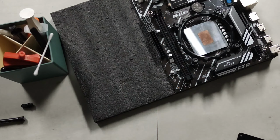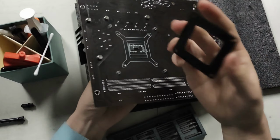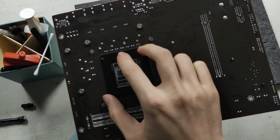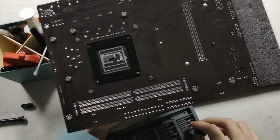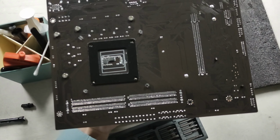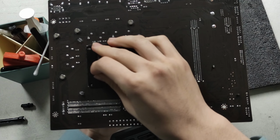Now we go to the other side and grab our triangular screws, which are really irritating to use. Since the back plate is a very, very simple design, honestly, I like this more than most other designs out there for even just standard sockets. This is better than that. And yeah, we're just gonna hold up the socket, hold up the CPU cold plate, and stick another finger in the middle of the board to balance it